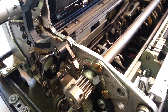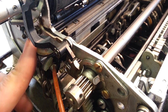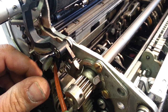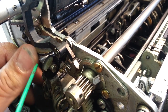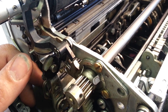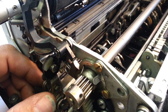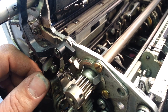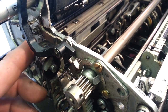Okay, now that they're dry, we will drop the oil on those two, right there, top and right on this little pulley. Turn around here, maybe a little shot of air to move the oil around. And let's try it. Let's release the tension on the ball. See how this pulley definitely feels freer. And the tilt pulley, good. Let's see if it still does it.